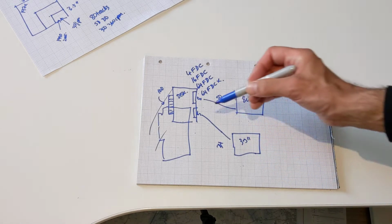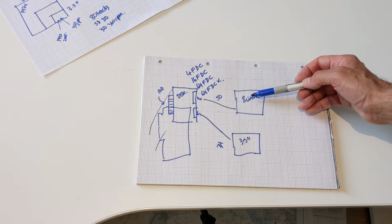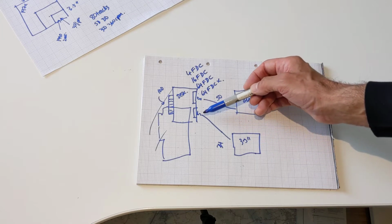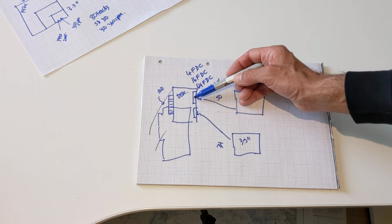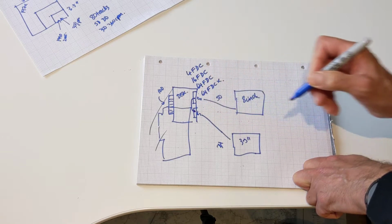And the electrical interfaces weren't quite the same. So when the computer actually wants to speak to the 8-inch drive, we're going to tell the Cromemco system that it's got another 8-inch drive, which is actually physically a 3.5-inch drive. But it's coming on this electrical interface, which shares many of the same wiring characteristics of the 8-inch interface, but not all. So there's a few little bits of wire to jumper here.